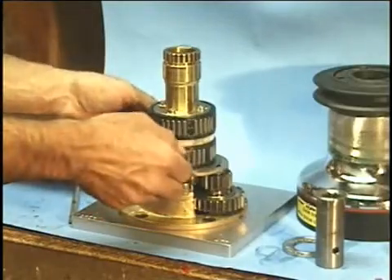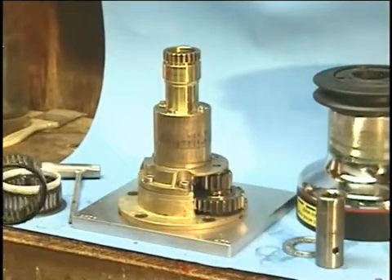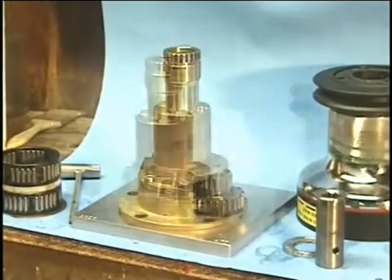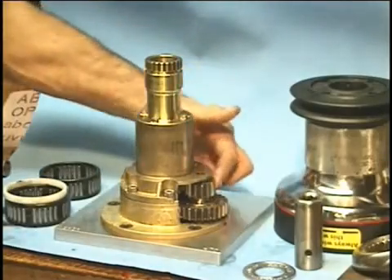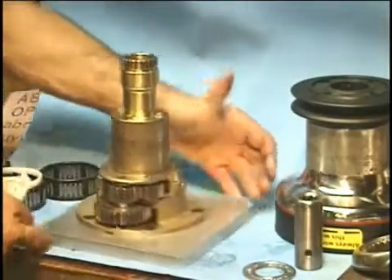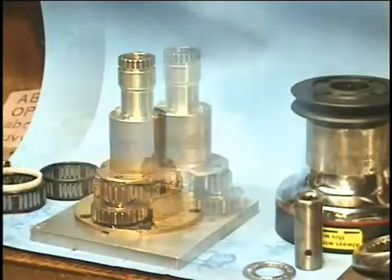The bearings need to be removed. You can take this thrust washer, lift the whole thing apart, and take that off. The bearings will need to be cleaned off — you can use a paper towel and just wipe like crazy, or spray a little carburetor cleaner or some kind of solvent on there and then wipe it off. This big bearing journal needs to be wiped off, the thrust area needs to be wiped off, and all the gears. It will require you to turn things a little bit — turn this pinion gear and expose all sides of the other gears. You've got the pinion gear and then the idler gear. Get those all cleaned up and re-grease with a nice thin coat of grease.